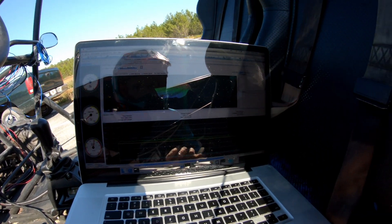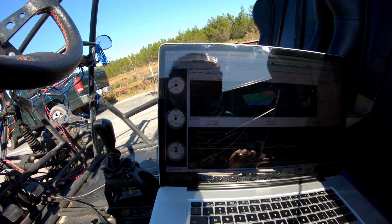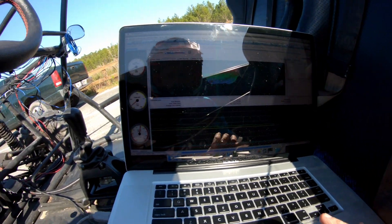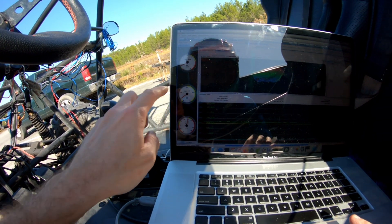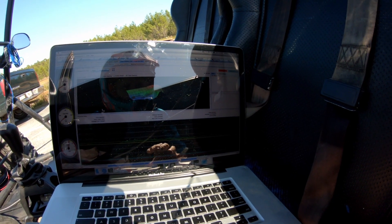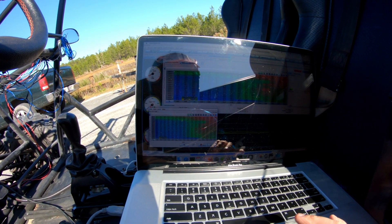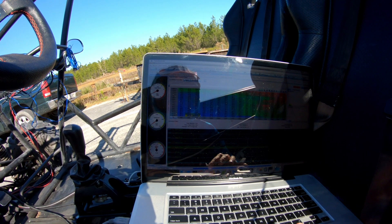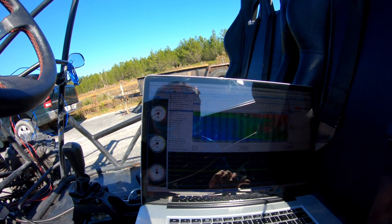So we're here at the trails. This is our initial tune — this is our VE fuel table, the auto start tune. You can see our air fuel, engine map, pressure, speed, RPM and so forth. I'm just going to start the auto tune, and literally as this thing sits and just idles away, what it's doing is pulling information from our AFR table.